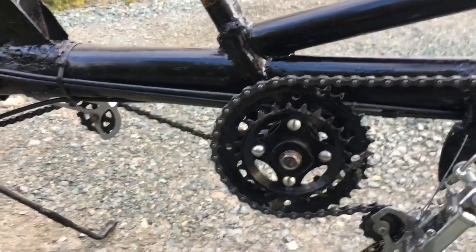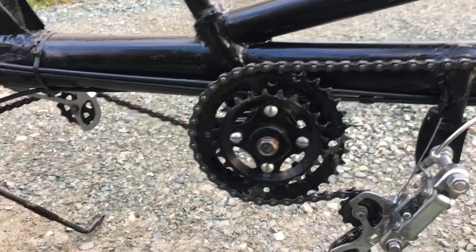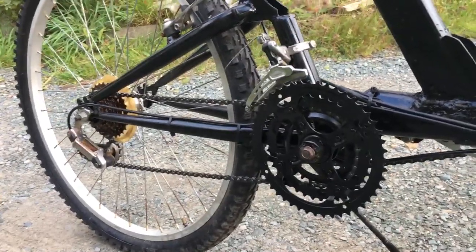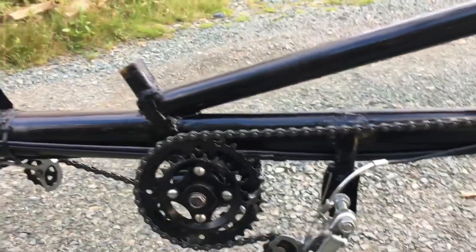The highest sprocket on this one is 48, the lowest one here is 24 — that's two to one. That's a great mechanical advantage: two to one above and beyond what you're already getting back here, which is a little better than three to one. This is how I do the three chains.